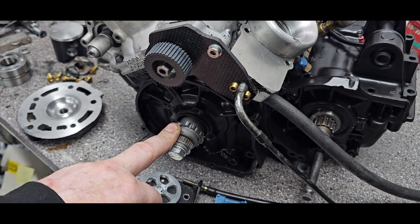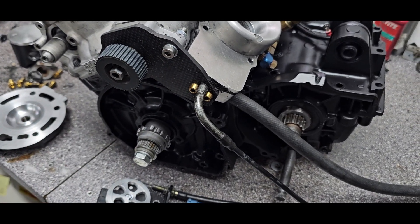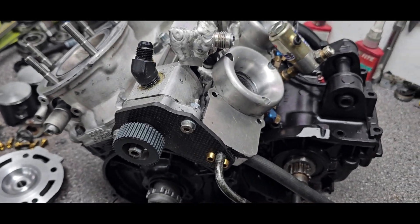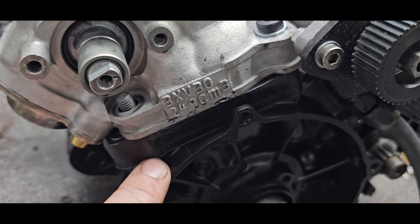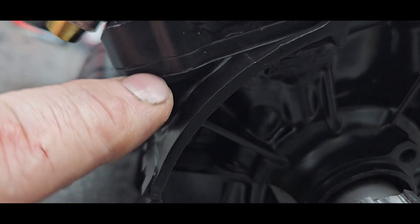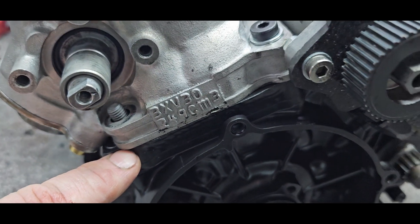So I can't put the engine together for the final assembly. Let's look at the cylinder. I have shimmed up with five millimeters extra — you can see the five millimeter shim right here, as the rods are five millimeters longer.